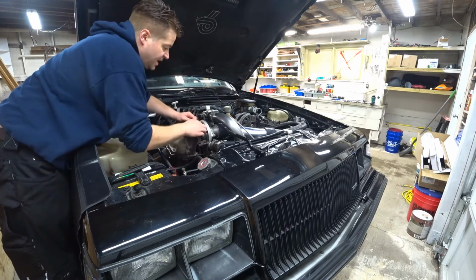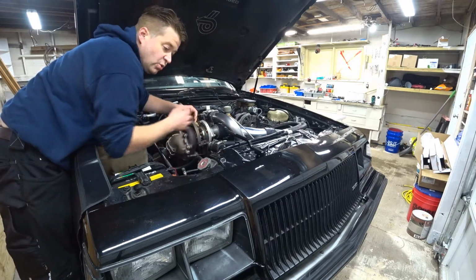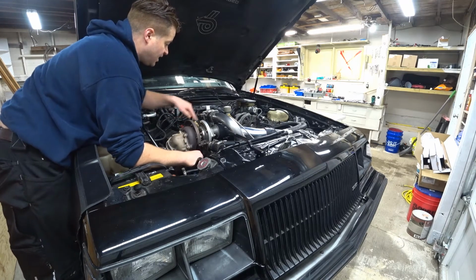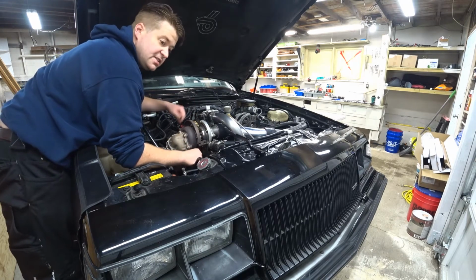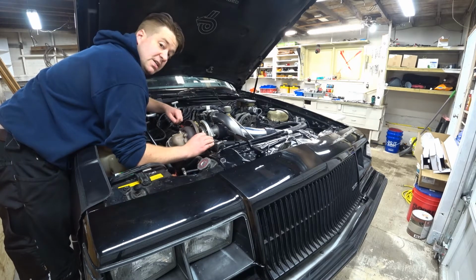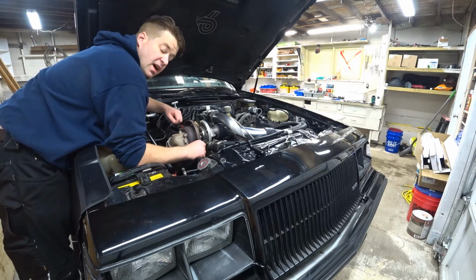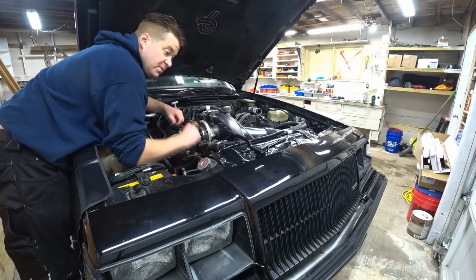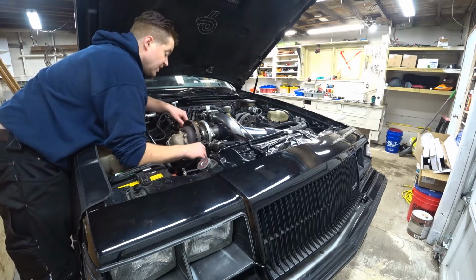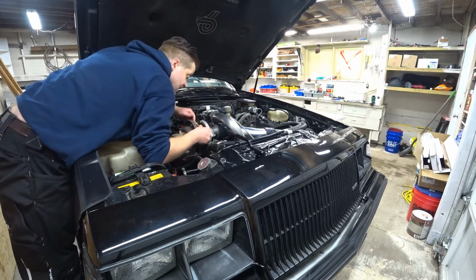On my Chevelle I made tranny cooling lines, oil feed line. I've made some various vacuum lines, fuel pressure lines, all with these kind of tools. And when you make it out of this, like when you do the fuel lines like I did with stainless steel, that stuff is much harder, and you are not going to bend that with your hands. I mean, it's extremely strong stuff. It's hard to bend with the tool. You actually have to press on it. This stuff is really soft and frankly really easy to manipulate.